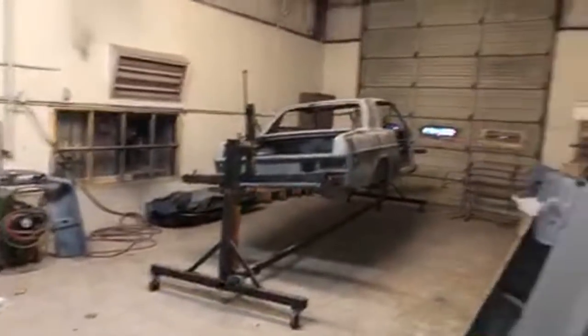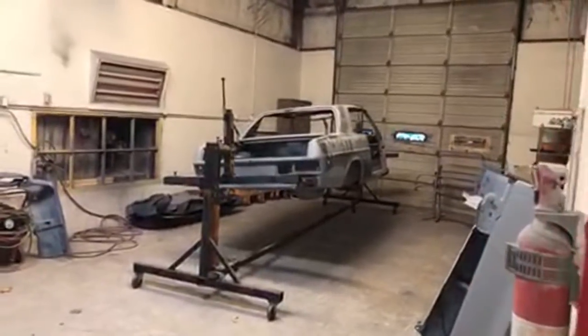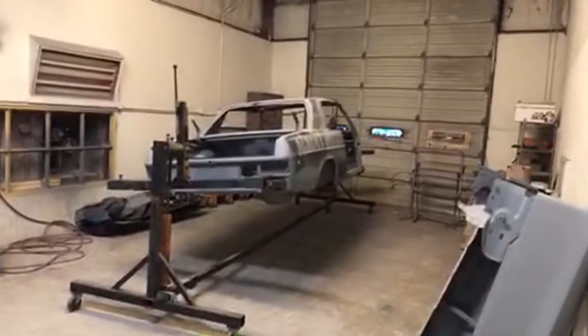We got our Mercedes over here. All we can see is it says 'nightmare.' I'm going to open this door very quickly and show you the difference in color. P3 2K primer is a high quality primer. But what you're looking at here is a spot seal job — wherever I busted through on my final block, I went ahead and spot sealed it. I didn't put sealer on the whole car. It's unnecessary.